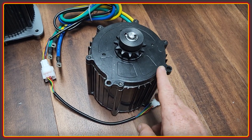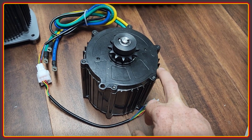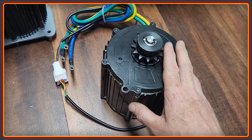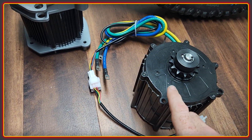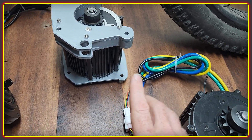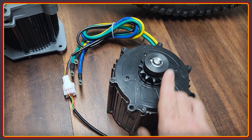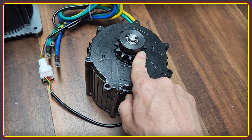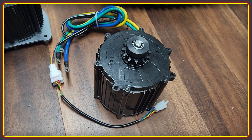We've run this comfortably up to 18 kilowatts and in excess of 60 newton meters, so plenty of power. Although size-wise it's not that much bigger than the XL size, it is considerably more powerful, which is why we're going to be using the 420 chain and sprockets with this one.